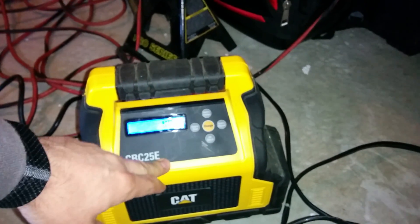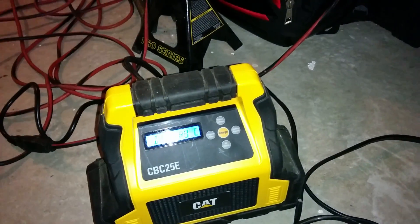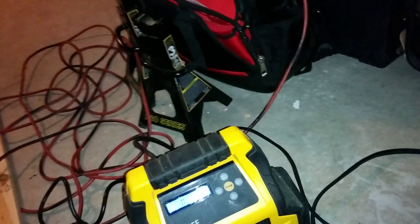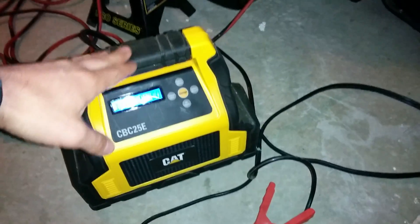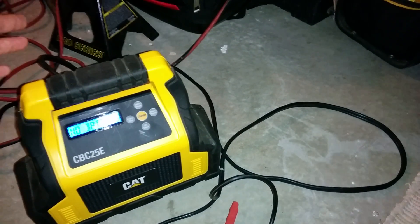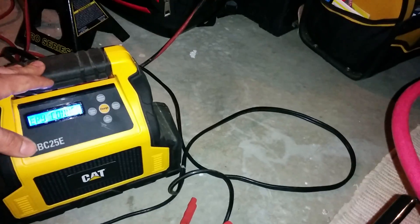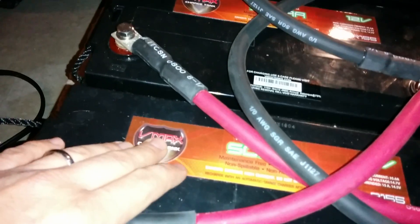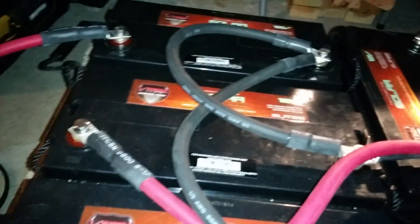We don't even need the battery charger today. But a quick word on battery chargers — this is my Caterpillar CBC25E. I'm not really trying to sell you anything here, but I highly recommend doing some heavy research on your own battery charger if you're looking to have an advanced setup. The industry has some issues with voltage, if you ask me. This here is a 25-amp charger — it's great and all, but it really doesn't matter as much as people think it does. All the fuss about how many amps your battery charger charges at doesn't really mean as much as you'd think. It really comes down to voltage. These batteries here, at rest, are 12.73 volts — that's a full battery. But when they're charging, battery manufacturer VMAX Tanks has specifically told me 14.7 volts. You should call your battery manufacturer and ask them what they recommend for charging — it's almost always between 14.4 and 14.8 volts.